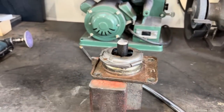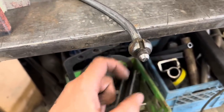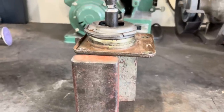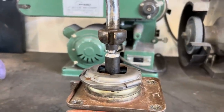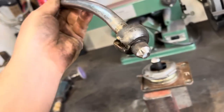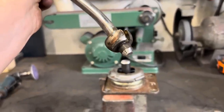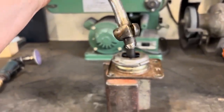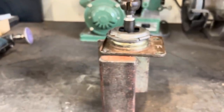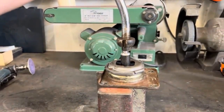So the top of the S10 shifter is cut off and the little neck part of the Swan shifter is cut off. So we can weld them together like that. Notice how I beveled this whole piece in here because it was, I don't know, probably about a half inch thick. And that way we can get a nice deep weld on there so that it doesn't break off when John is slamming through the gears. So I can weld this up now.